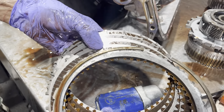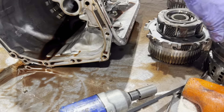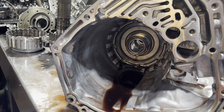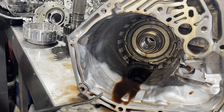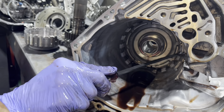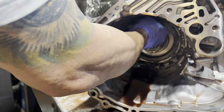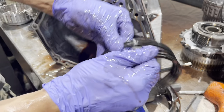This is our low and reverse clutch pack — these are almost never damaged. In here there's another snap ring that's holding in the spring retainer, so this is kind of under tension and you've got to work it out little by little. There we go — snap ring, spring retainer, our slinky.